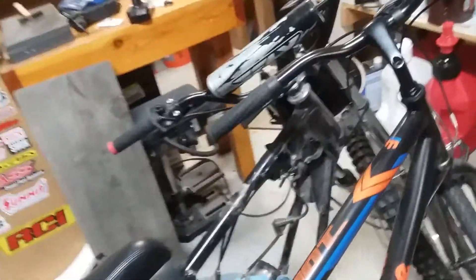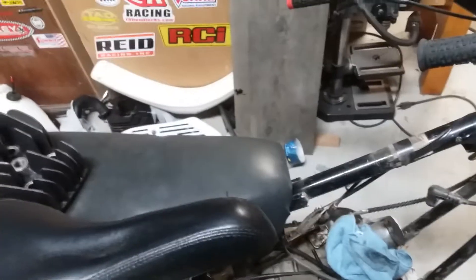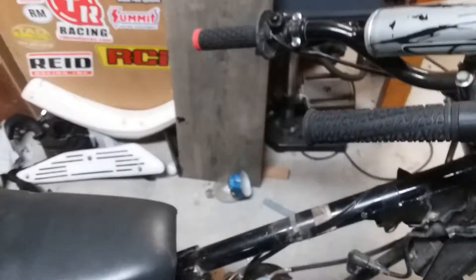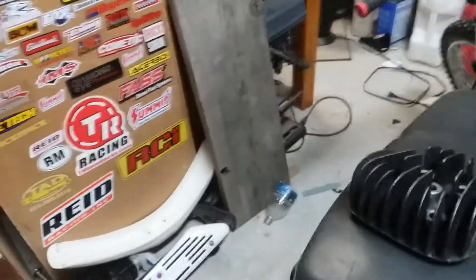Anyway, that's an air-cooled engine — it's simple. That's what the first dirt bikes were: air-cooled. They switched to liquid-cooled because they figured out with motocross that these engines run so incredibly hot that the air-cooled ones just kept blowing up and wouldn't last very long. One of these days, probably after the end of the year which is in a month, I'll take the cylinder to the motorcycle shop to see what's wrong with it.